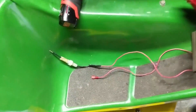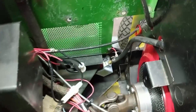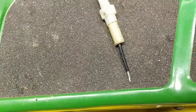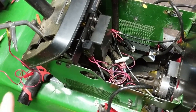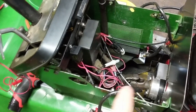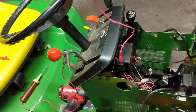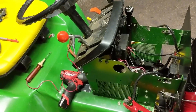So the fuel pump was hooked up via this wire here — this plug right there went on to that end where the fuel pump is, and then the other fused end, which I've cut, went up to this wire here from this relay. The next thing I wanted to do was when I turned the key on, test to see if there was 12 volts in that line — this was before I cut it. So I unplugged the connector there, hooked up my test lead, sat on the seat, had the key switch on, and the light on my probe did not light up.